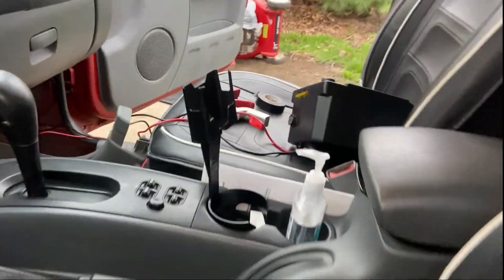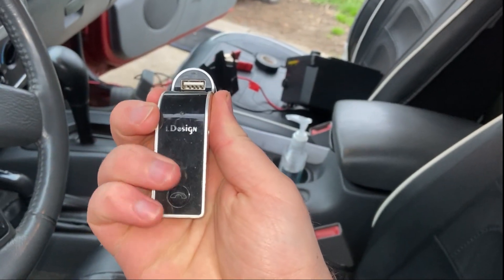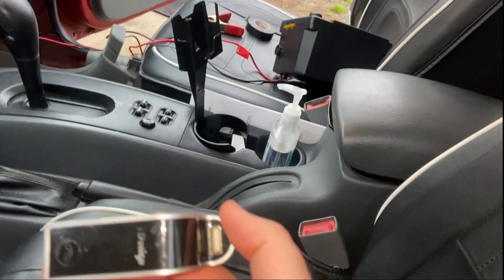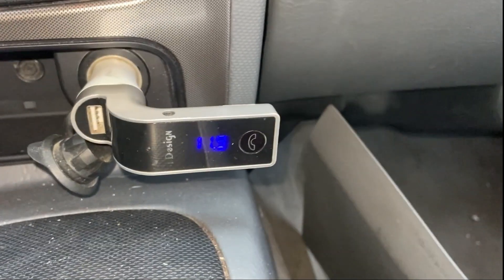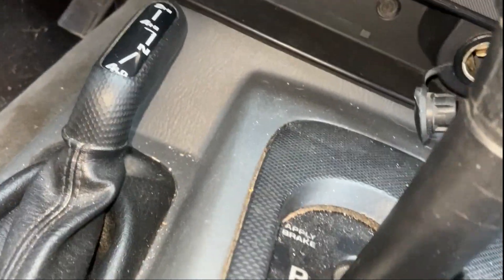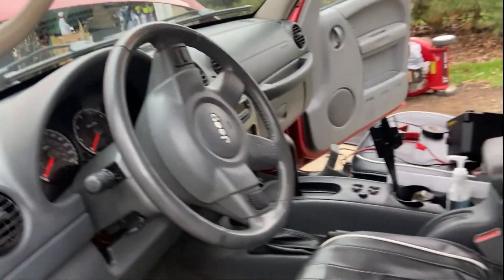To watch the voltage in my car — which is important so you don't strand yourself — I have a Bluetooth radio plug that I used to use in an old car, and it will also tell you the voltage of the car socket. Right now it's just sitting at 11.9 volts with the car off. When you're running the heater with the car on and all your accessories like lights running, you want to make sure it's around 14 volts. If it's anywhere near 12.8, you will be drawing from your car battery, and that's a no-go.